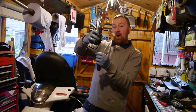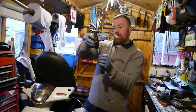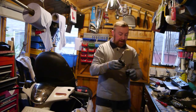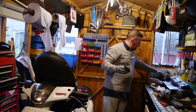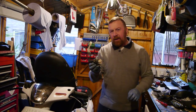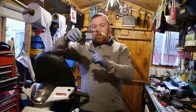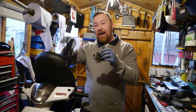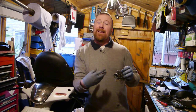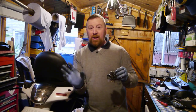There's a little bit of fuel in here and I'm keeping it. I've had this carburetor apart a few times. Now — upjetting. I speak about it quite a bit. More fuel requires more air, and requires the exhaust gases to get out. Those are the three things you need when upjetting. Most of the ones I've done, I take the link part off the Speedfight, there's more air, it's already got a sports exhaust, and then you can upjet and away she goes — happy days.